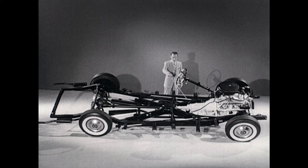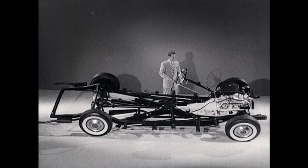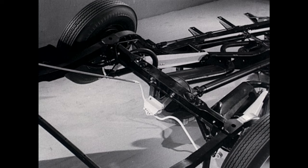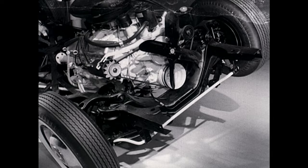Let's look at the torsion level suspension on the new Packard. Here you see the torsion bar spring. It's mounted on the frame, attached to the front wheel through a lever, and to the rear wheel through a system of levers. There's an identical system on the other side. This system counteracts the tendency to pitch by connecting front and rear wheels so they work as a team. In addition, stabilizers or sway bars at the rear counteract swaying from side to side. There is also a roll bar between the front wheels to reduce rolling.